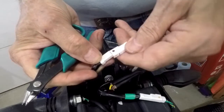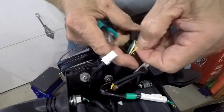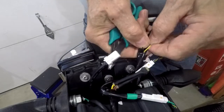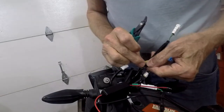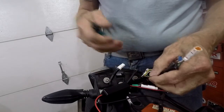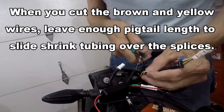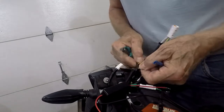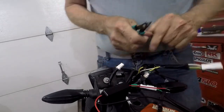The wire in question is going to be the yellow wire that I want to pull out. I'm going to go ahead and do two cuts in here. To give myself plenty of room, I'm going to cut the brown wire and I'm going to cut the yellow wire. Then I'm going to get rid of some of this extra casing, because we'll follow up with shrink tubing.